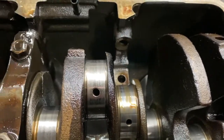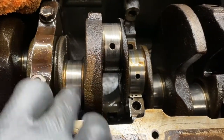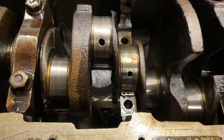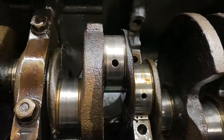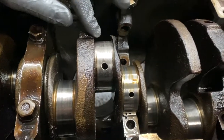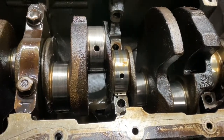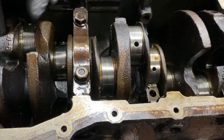Even this journal — you could polish it up since there are really no grooves in it — but this one has all the ridges. If you try to true that up, it's going to be out of spec and you'd have to regrind them all. So I'm just going to get another crankshaft. Number five had so much heat here, and that's what was creating the engine noise and caused the engine failure.